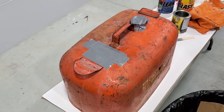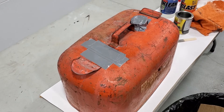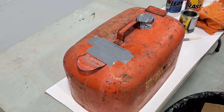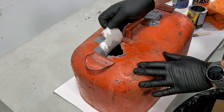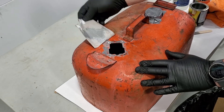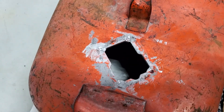We're back. We've rotated the tank for about 20 minutes and we're pretty confident the coating is all throughout the inside. We're going to take the tape off one side — this is where we'll dump out the excess. Looking in there — yes, we can see the tank sealer coating the inside.